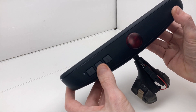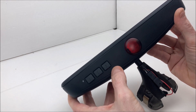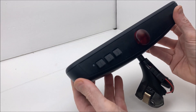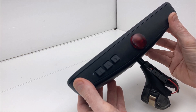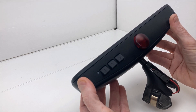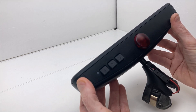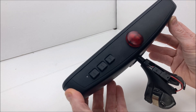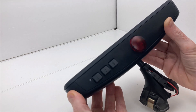This mirror has integrated HomeLink and an alarm LED on the bottom. I really couldn't utilize the existing alarm LED as-is because it runs through the circuit board of the mirror and doesn't blink on its own — it relies on a signal from your alarm to blink the LED. My EOS does have an alarm, and I could run additional wires to track down the alarm brain and tap into the alarm LED wire, but it's an awful lot of work and I just couldn't find a security system diagram.